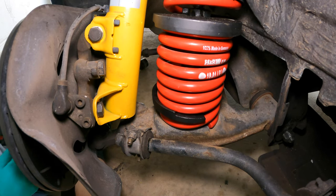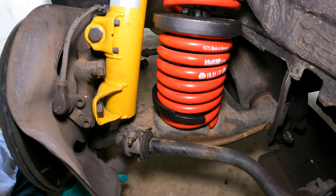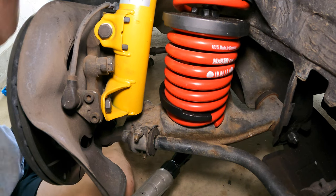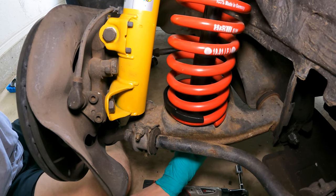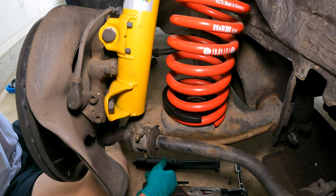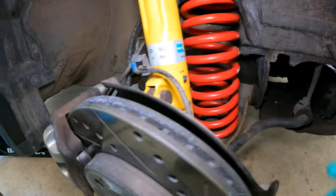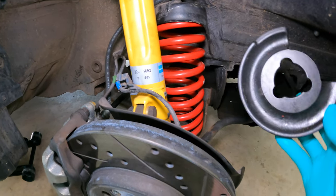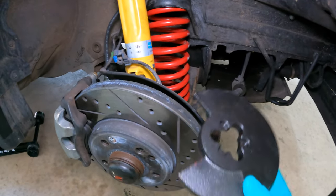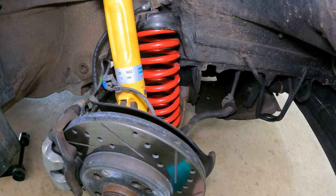I put the new shim on — it took about two seconds. When you come back here just make sure you line up the edge of the coil spring to have a good seat. Then very slowly back it into where it's supposed to go. One issue I ran into: the upper part was getting stuck into the shoe, so I had to use the larger tool, place it there, cinch it up, and then I was able to get the top one out. Just something to know if that ever happens to you.